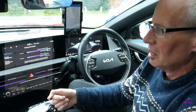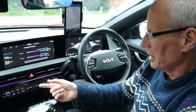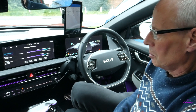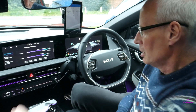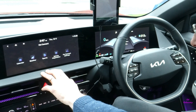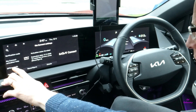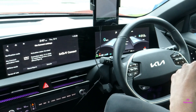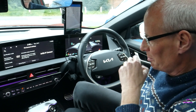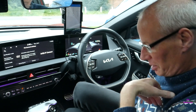If you're going to leave the car locked in the garage for a month while you're away, it's worth turning off Kia Connect by putting it in offline mode, in case it's dialling back to the service and slowly draining the battery without topping itself up. To do that, just go into Kia Connect, then Kia Connect settings, and then press offline mode. That basically shuts the car up and will not run the telematics. Obviously if it was stolen from the garage you wouldn't be able to track it, but if it's in the garage it's more likely to be safe anyway.